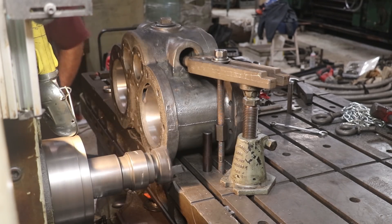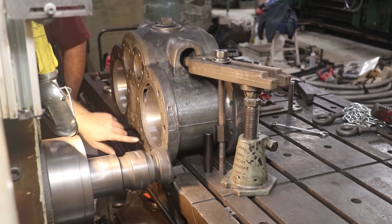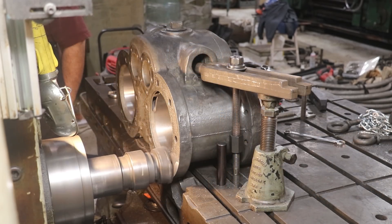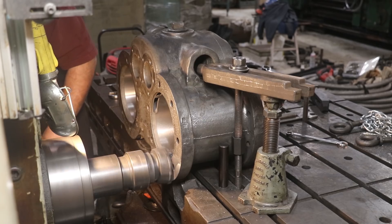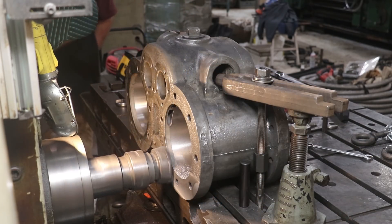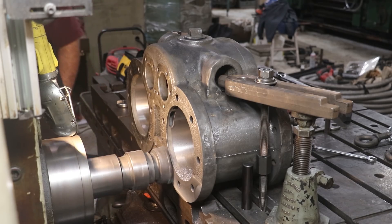A 15 thousandths cut here it looks like. Let's see if we get lucky — I'd say it's going to take more than that, probably twice that. Some of these pits in here are really deep. That's not looking too bad — the worst pitting was right back in here. There's a couple little holes but they look outside the gasket ring, so we're good. I think that'll do it.